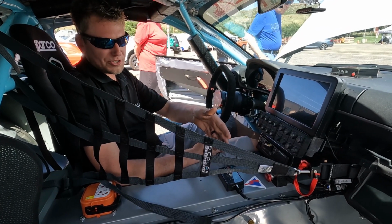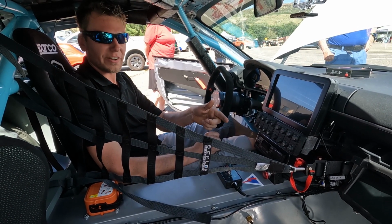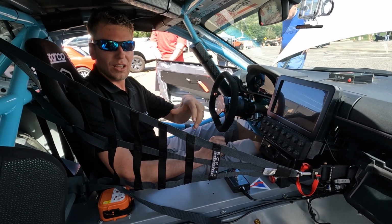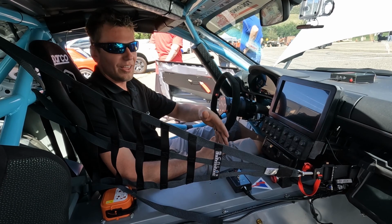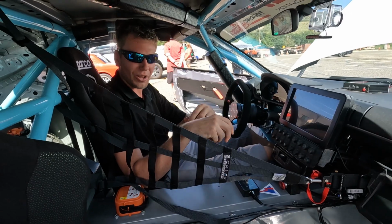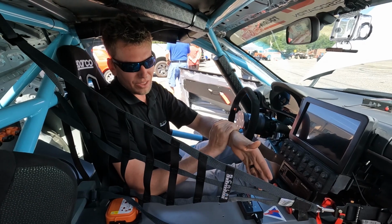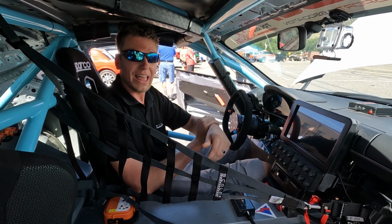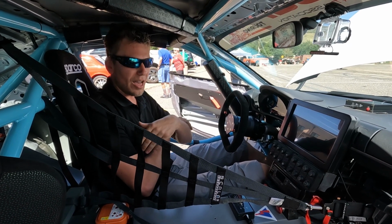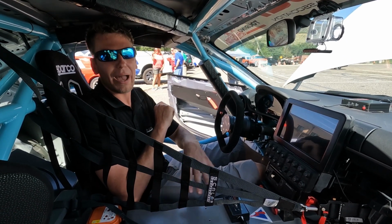So to the fire suppression system, like I said, we work with Lifeline. This is the only battery-powered vehicle that actually has fire suppression going into the battery pack. Now, is that going to stop a thermal runaway? No, we did math and calculated with Lifeline. The actual necessary volume that we need to sustain a thermal runaway and suppress it is so massive, it's just not practical to carry it on a car. So we run their standard 5-pound fire suppression bottle. It's Novec 1230. If it does get deployed in the pack, it won't wreck the pack. It won't be a big massive cleanup mess afterwards. You can basically deploy it and then recharge a cylinder and the pack is still good to use.